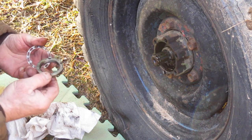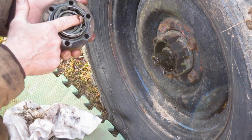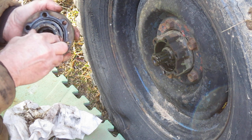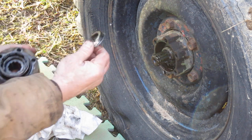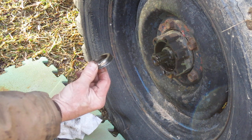When you get automatic hubs, in here there's a set of clutches — fiber clutches — around here, and this goes in there to make that automatic hub work. It goes in opposite of where I took it out, so the spindle nut won't back off.